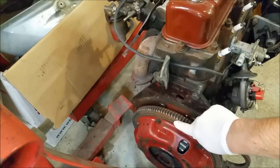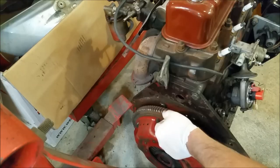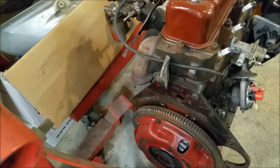Of course the flywheel is shot. Oddly enough it didn't screech and didn't make any noises on starting, and I've had this vehicle for 12 years. It was surprising also that the Bendix gear doesn't appear to be damaged - it's just the ring gear. On a Ford, the bolts that hold the flywheel are staggered so they only go one way. This could have been screeching and a mechanic might have just rotated it 90 degrees or thereabouts, making it so the engine starts on the good teeth, not the bad ones.